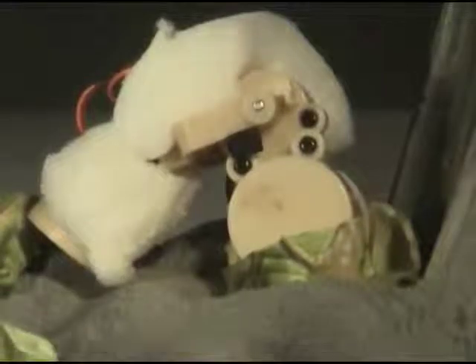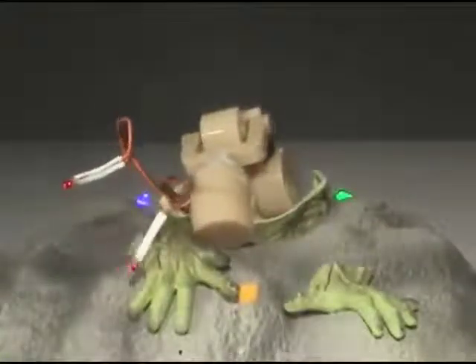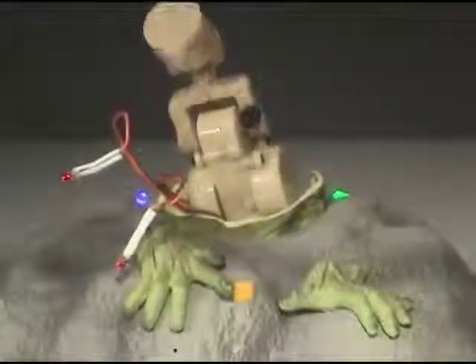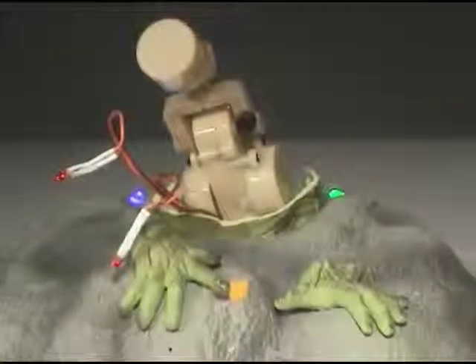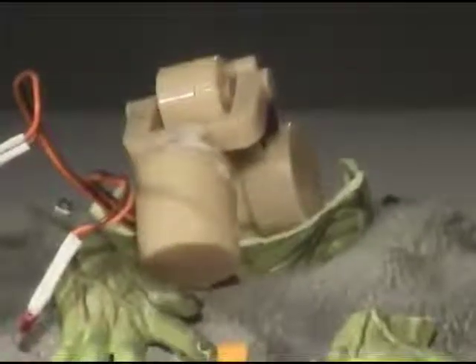Here's just a side view of it. Those are his eyes — those red LEDs — and here's the apparatus. What makes this thing jump: there's a motor at the bottom. Gearbox cover on the right-hand side, and you can barely see a drive belt on the far side. What makes this thing jump is just an offset weight on the other side of the motor shaft, making the motor vibrate — a little brass weight mounted off-center.